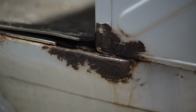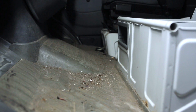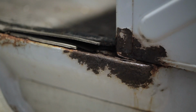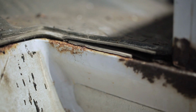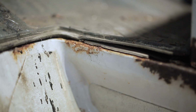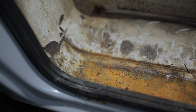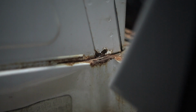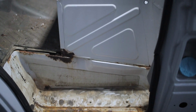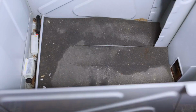Lack of prep meant that water was running down the inside of the glass, disappearing behind the dash, and hey, out of sight, out of mind, right? And sneaking its way through any little gaps it could find under the rubberized floor covering. It was pooling under the seat bases and in the footwells. This guy's hoping it's just created some more surface rust that can be brushed back, prepared and primed, but it could go either way. So the next job on the Mercedes Sprinter van is to strip the cab in search of water damage under the seats.